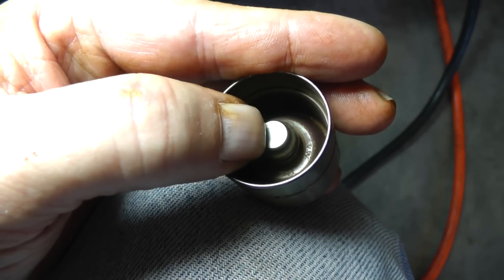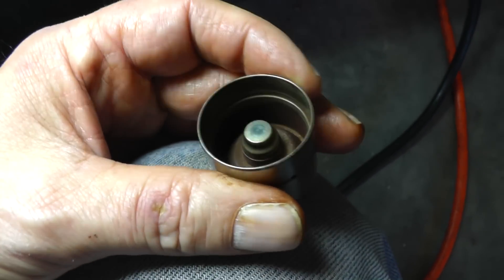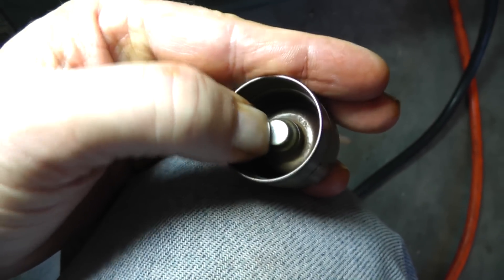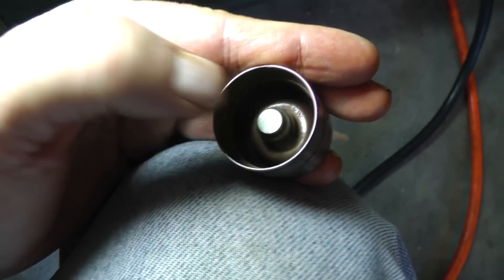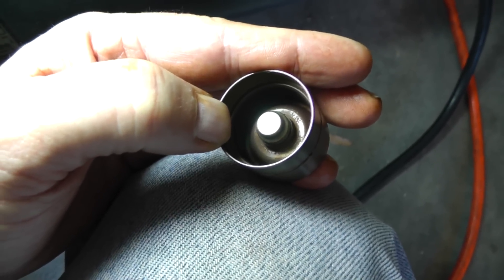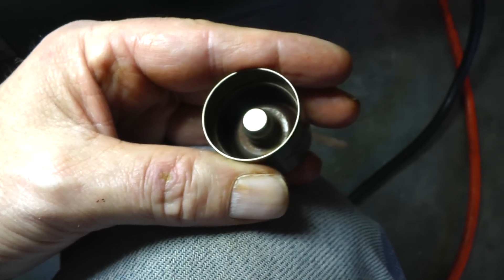Rather than taking a chance that this could be stuck out just a little bit and possibly holding your valves open, which gives you misfires. The machinist actually told me he's known cases — he doesn't think it'll be an issue with this engine — but with some engines, if the lifter isn't bled down, the valves can be held open enough that the piston will come right back in there and bend the valves.